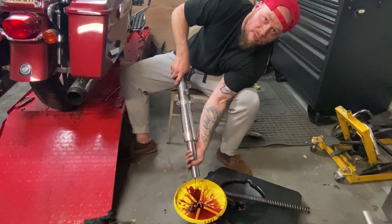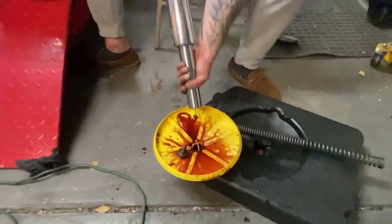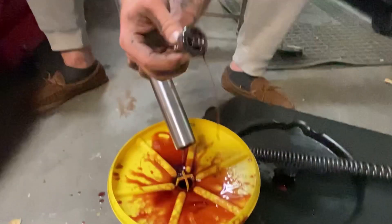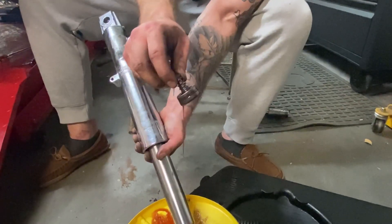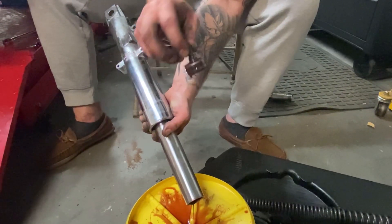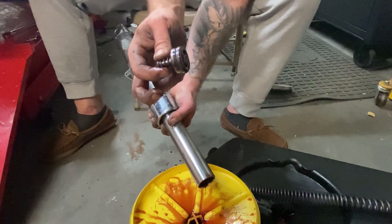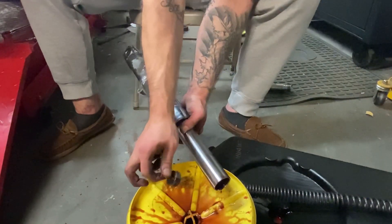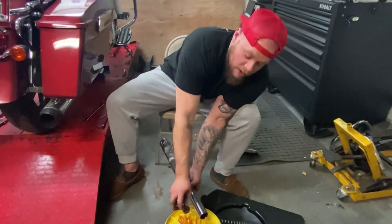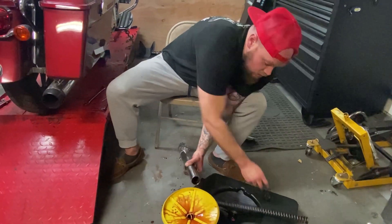There's a little valve. You won't have these valves in pretty much any other Dyna sport unless they have race pistons in them. The touring bikes after 2006 have these little cartridge emulators already in them, which is kind of cool — even though they're not that great, if you run them with a decent spring they actually function okay.